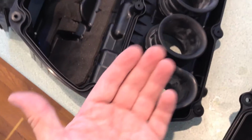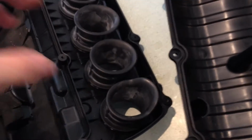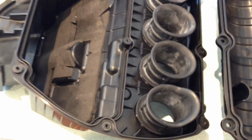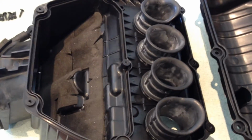So that's basically it. Oh, and I forgot to mention that the airbox does get a little oil in the corner here from this side, because of the hoses that connect. That's why this is my memory jogger. The engine recycles evaporative emission control measures, some of the crankcase blow-by gases, and those have some oil in them, and it is meant to be trapped here. There are also other canisters exiting from this hose here that catches the oily sediment from the blow-by gases that get recycled. There's an environmental measure here for the airbox. So that's also why you have oil inside here on the filtered side of the airbox.